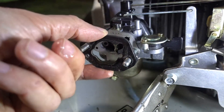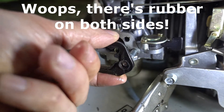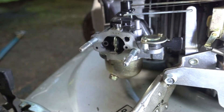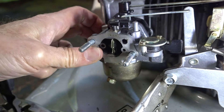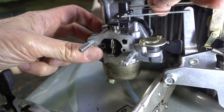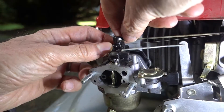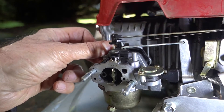You can move this plate and gasket — the metal side of the plate is outward and the rubber side faces the carburetor. The carburetor doesn't exactly pull off because of the linkage. Unfortunately, this linkage doesn't just pop out.